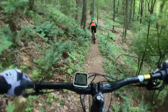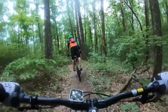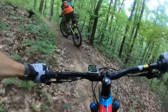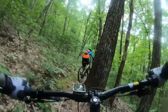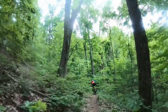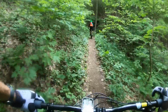I had been riding this bike back at home without a Camelbak, and here I really loaded up my Camelbak. It probably weighed 15 pounds, loaded down with water and tools and food. And so the sag was too high, and the shock really didn't feel good. So you've got to nail the pressure. I'm running pretty much my weight with the Camelbak on as the PSI I put in this shock. After I did that, it was really dialed in. It's a really supple feel when you're descending. So this is a great spec on this bike.